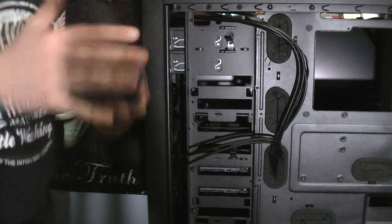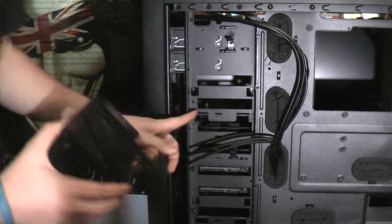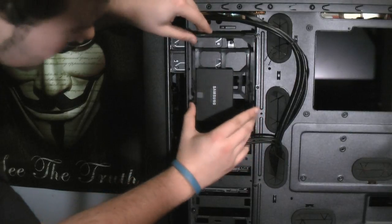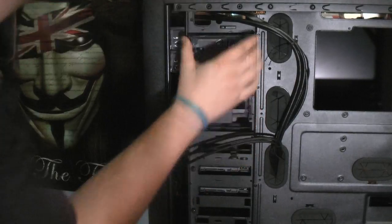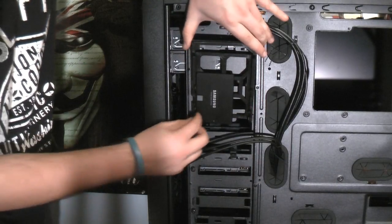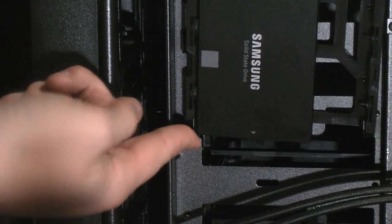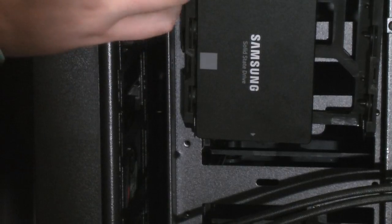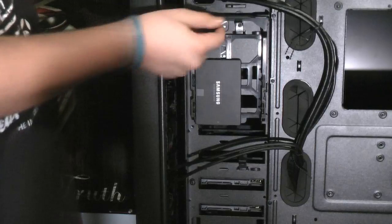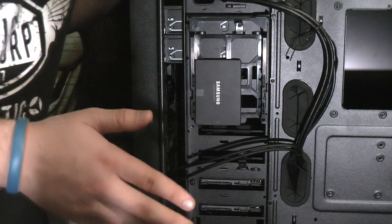You can put it in facing in this way — you see these little rounded ends and these little hooks that are kind of hooked in. What you're going to do is put it on like that, then pull it down — literally as easy as that. So you put it on there so that both of these little hooks are on the inside of the cage. You push it in so it's on the inside, then simply push it back while lifting it up a slight bit so it stays centered as it clicks in. It clicks in with this little notch right here. If you want to take it out, hold that down and lift up. It works the exact same way for hard drives as well as SSDs.